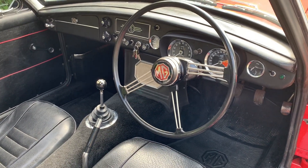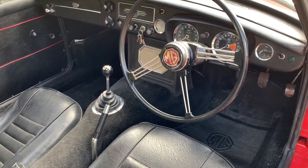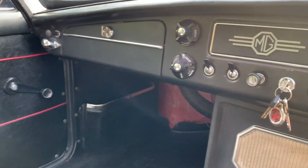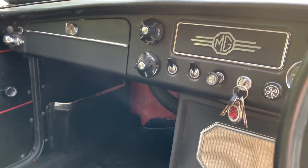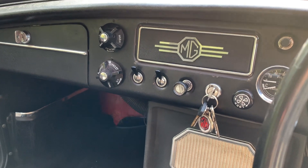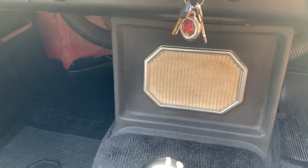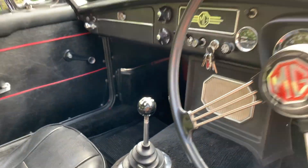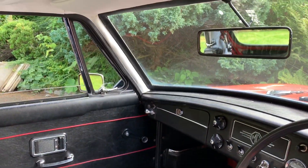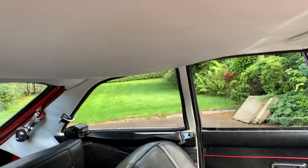Check whether the car has the right steering wheel. This is the correct wheel for this car — they call it the banjo type for obvious reasons. When I got this car it had a horrible aftermarket steering wheel, so I hunted high and low to get the correct one. In the dashboard, check this wrinkle-finish coating — mine has a few chips that will be dealt with. Some cars have a radio fitted and even a hidden speaker behind the dash. Also look out for windscreen delamination, which this one has.